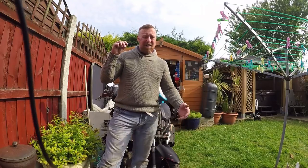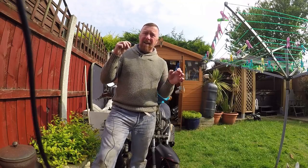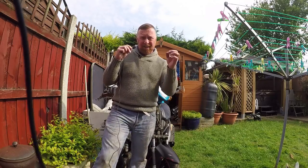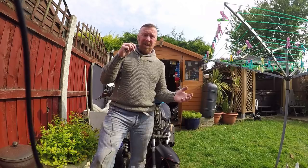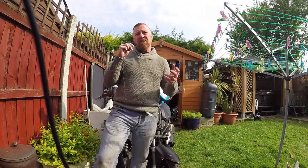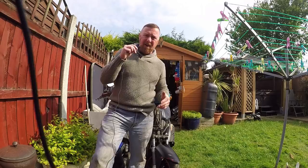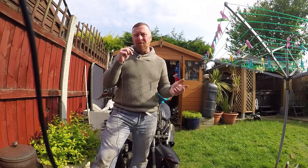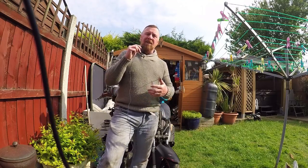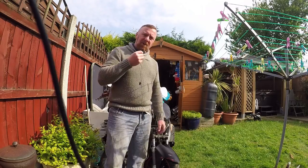How do I tune them? It's really hard - you've got to mess around with the tuning, oil mixing, because remember your oil pump is set up for 50cc and it's really set up for 30 to 40 miles an hour. When you're doing 50 to 60 on these, I always suggest you add a little bit of 2T oil in with your petrol when you've got a 70 kit. You have to up the plug too - if it's a BR8, you need a BR9, because of temperature. Up the jet, more air in - lots of problems. That's why I stick to 50cc's. You can make these go really really fast, so why bother doing a 70 kit?